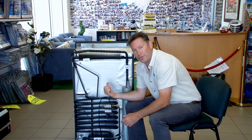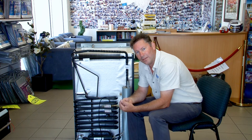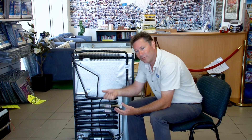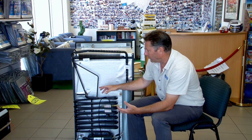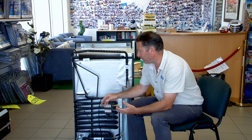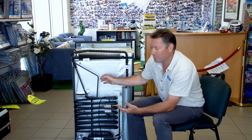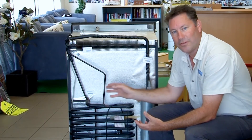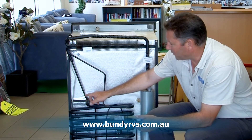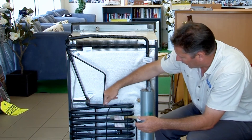Removing heat means if the inside temperature of your fridge is at 10 degrees, when the ammonia and hydrogen go in, it removes heat. So it might remove one degree of heat, bringing the fridge temperature back to nine. This is where you use your thermostat inside to adjust the fridge temperature — in the freezer it might be minus something, but in your fridge cavity it could be six degrees, and if you remove two degrees of heat, your fridge is now at four degrees. Once the ammonia and hydrogen go through here, it comes back out through this pipework here.